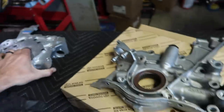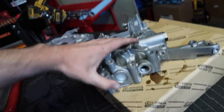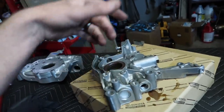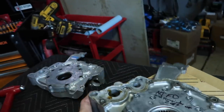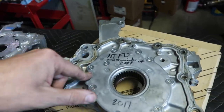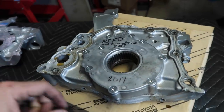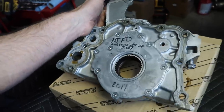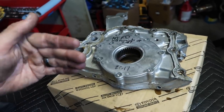I'm going to take this apart with you guys. What I do is start with a stock oil pump — it will not have a front main seal, it'll look like that, but otherwise it'll look just like this. It'll have a plug in here, but this one doesn't because I remove it for the other oil system. What you've got to do is flip it over and take this rear cover off, which exposes the gearing for the pump. You'll need the proper tools to port it.